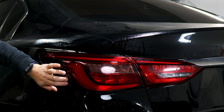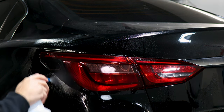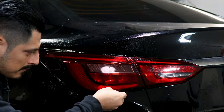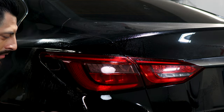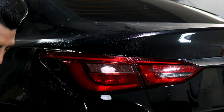Once you have this tacked down, work your way around the tail light, apply your tack solution, and little by little start tacking down. Once it's good, apply heat so the film starts molding to the curve from the bottom and from the top, and just work to that end.